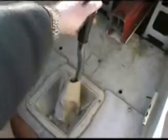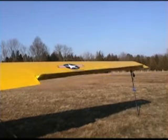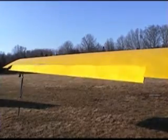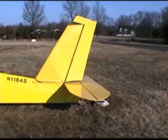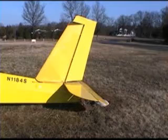Now let's manipulate the controls. Move the stick forward and back to manipulate the elevator, and to the left and right to manipulate the ailerons. Move it to all corners in an almost circular or square motion so that you can move all of them at the same time. While you're doing it, look at the ailerons so that you can see them moving. Check that the elevator is moving up and down as it should, and then pull on the rudder cables to see that the rudder moves left and right.